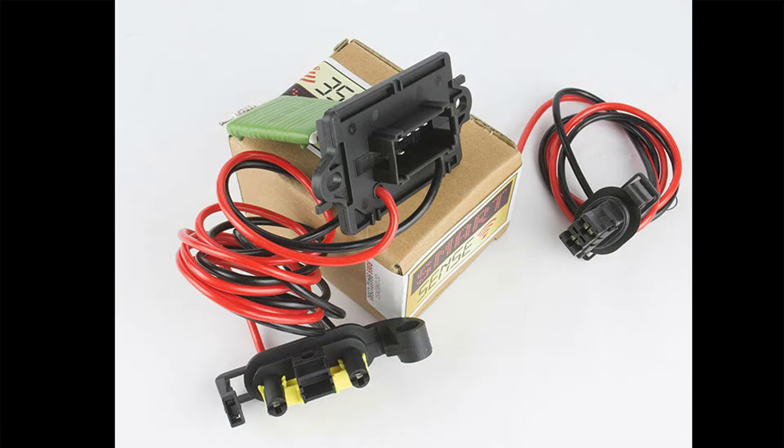Sometimes you might need to change the whole assembly, but sometimes you might get away with changing the thermal fuse only. I will leave a link in the description with an article with more information about that. Next thing is the relay — usually you want to check the relay last as they are unlikely to go bad. The relay is located right here in this black box. You can take the box out, take the relay out, clean the connections, and test if the fan will start. If that doesn't help, you can take the relay out, power it, and listen if it clicks.